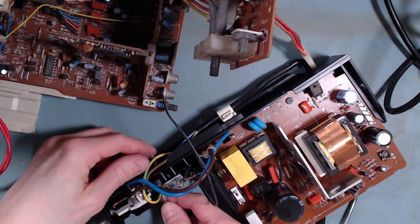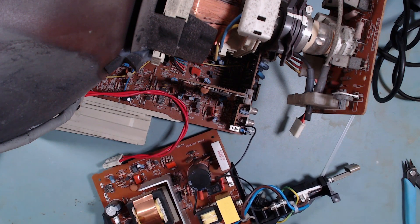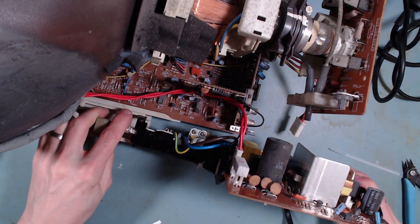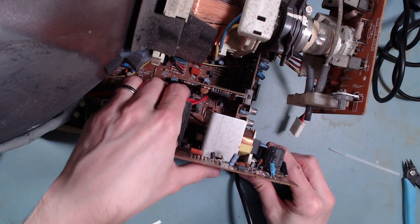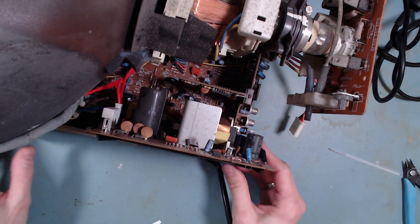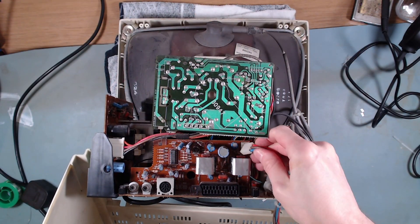Next, we need to restore the cable tie, and once done, we can reattach the plastic button, making sure we get it the right way around. Next we can reconnect the degauss wire and slide the power module back in, taking care to move the degauss wires away from the electronics inside. Finally, we reconnect the power to the rest of the monitor, and screw the case together.